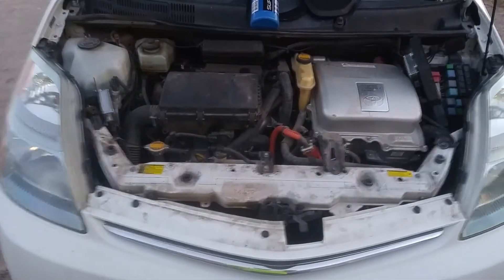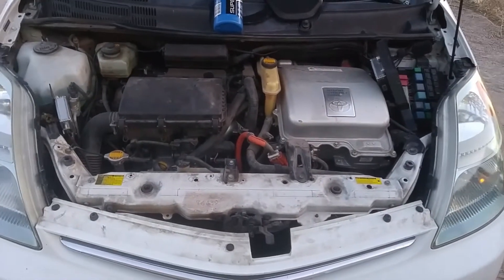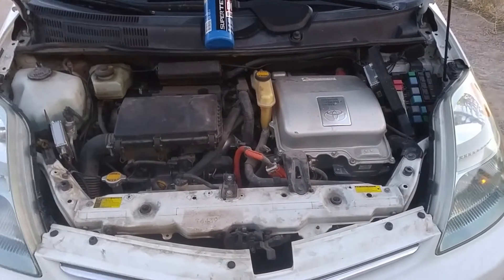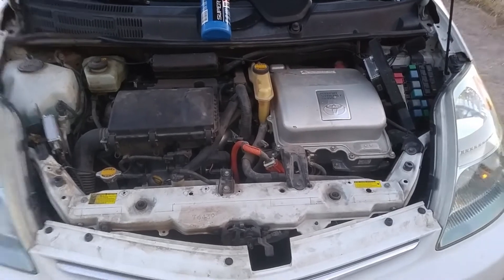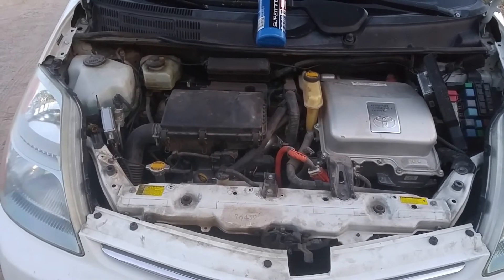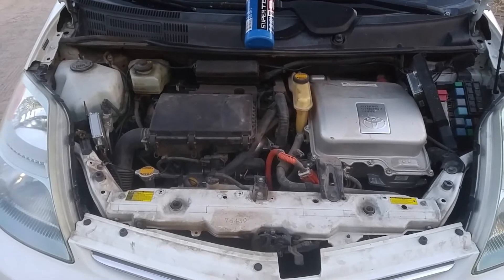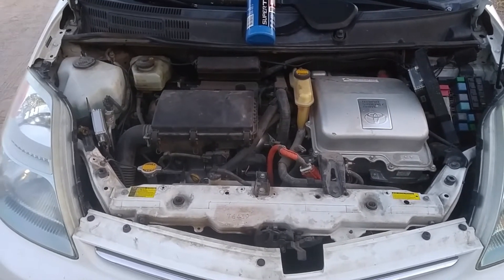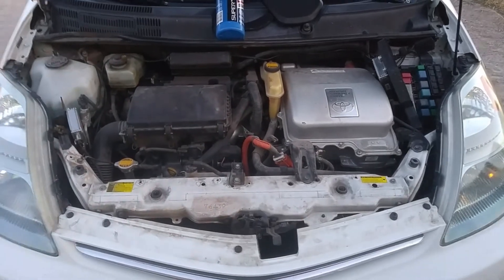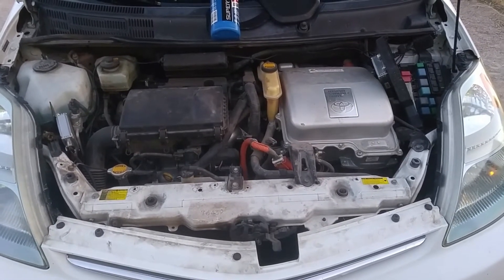I've done that bleeding procedure. This is a better improvement than normal. The one thing that I did today was I let it run for a long time, especially when I did the left rear — I cycled a whole bunch of fluid. On that one, a bunch of bubbles came out. Some came out, and then when it ran out of accumulated pressure and it made the different noise, more bubbles came out and they streamed for a while. I shut the port, opened it again, and got a few more bubbles a second time until it stopped. I did that a couple of times. Then I did the right rear, which I showed you on camera — that one I didn't get nearly as many bubbles. But now the accumulator pump is not running. Normally it cycles on, stops for a few seconds, cycles on — almost continuous. After I do this procedure, it stops doing this.